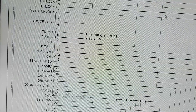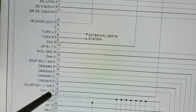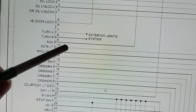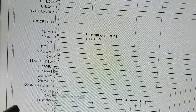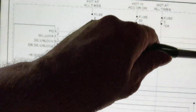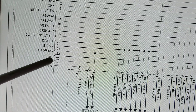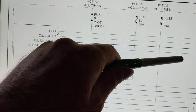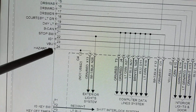All I know is it needs at least 12 volts coming into pin 19 from fuse number 3. So we have two fuses already. Then another 12 volts going into pin 22 - that looks like ignition. And another one - 7.5 amps - going into pin 7, and another one going into pin 23.